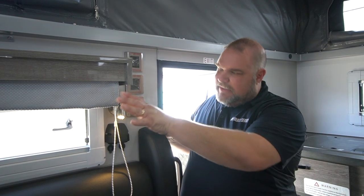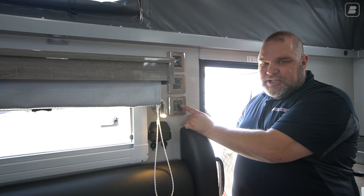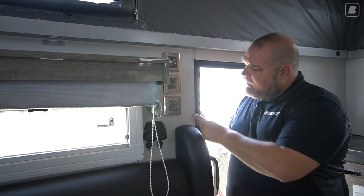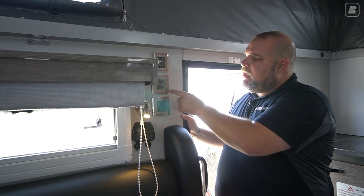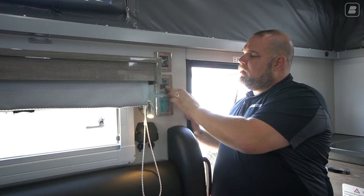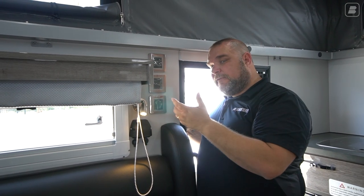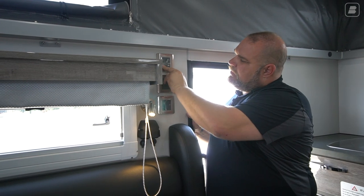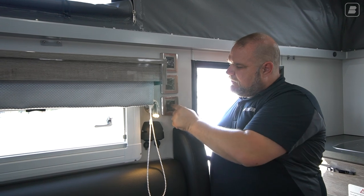Here I am back by the door. We have this row of switches. The very large square one is your battery cutoff — if I switch that, it shuts off all my power. But again, it's not a true battery cutoff; we have to get to the switch underneath the dinette seat. We have double switches here — a single rocker that only goes one way. These switches turn off the puck lights, the ceiling lights: one shuts off one section, the other shuts off the back section. Then we have the top one, a rocker switch that rocks both ways — these are for your outside floodlights. Click it to the front and the front lights come on; click it to the rear and the rear floodlights come on.